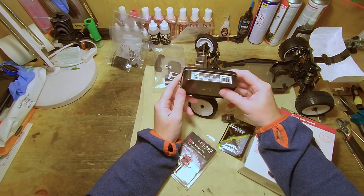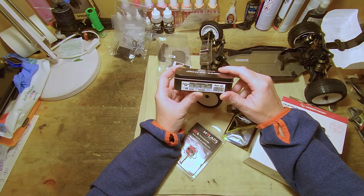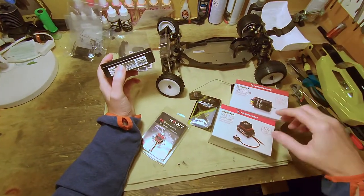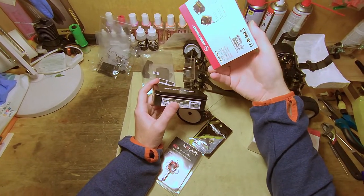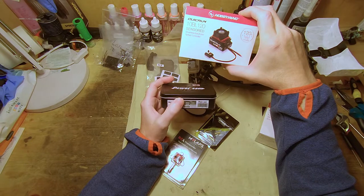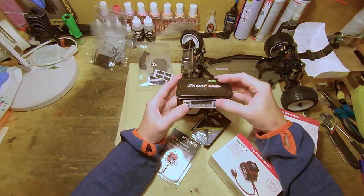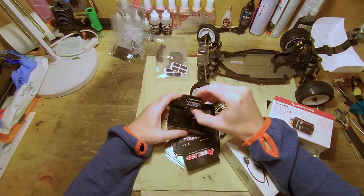And this is maybe not the right servo I bought. It's a power HD. It's a servo that can take up to 8.4 volt, of course. But this ESC here has a BEC that only delivers 6 volt. That's also something you have to think about when you buy this ESC. You have to see what servo you are using, because you have to get the torque, the force, and the speed on 6 volt as you need. So I'm not sure if this servo will be fast enough and strong enough on 6 volt, but I'm just going to try it.